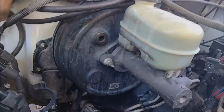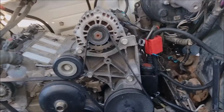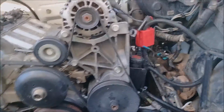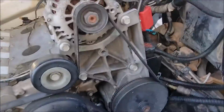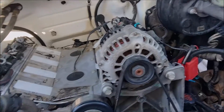I need, this is fuel injection hose. I'm going to trim it, but I need to get the smaller return. The parts store has them, so I'll get that. If your truck is returnless and the engine you're putting in is returnless, then you're set. But I've got this hokey combination here, and I've already got a return intake off of this engine, except it was drive-by-wire, so I'm going to convert it to drive-by-cable, and then I still have the return and everything. I could go either way, but I prefer return, especially when you get in the boost. I prefer return, but trying to think of what else.